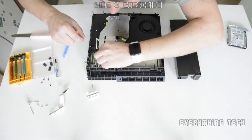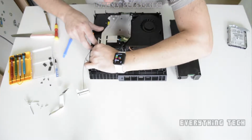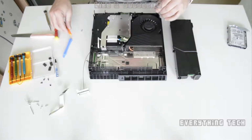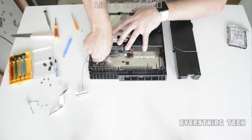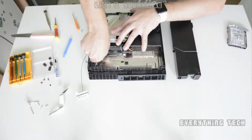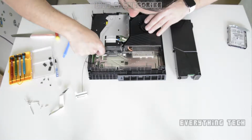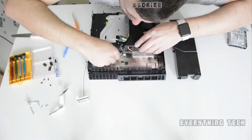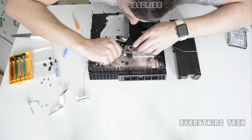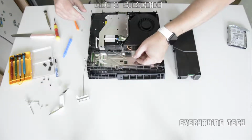So take out that one first, just wiggle it, same sort of connector as you get with the power supply, but this one is actually plugged onto the motherboard itself. So wiggle it out until it comes loose, take it out, and then run the cable all along the little grooves that are securing the cable against the housing. Keep on unhooking it from the little hooks, and once that's done, just put it aside.